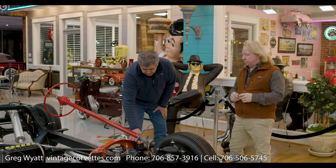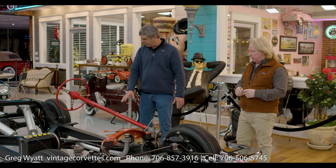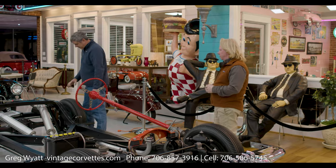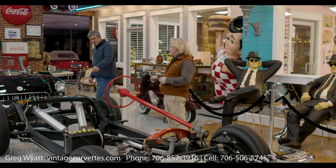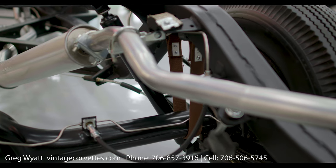Now you have all your DOT plumbing for the brakes — all new, all new, taken off, redone. New cables, new hardware for the braking system. Tires, sway arm, bushings, bolts. Axle straps, correctly done, riveted with correct rivets.